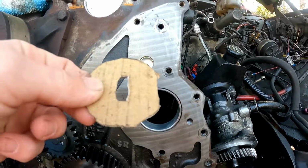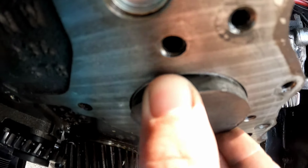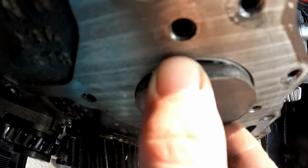All right, y'all see the cardboard? Now looky here. I made this out of 3/8 inch steel so we can put these notches in it, because you might have thought, well, Avery, how would you get this centered on the cam bearing once it's inside the block? But just like that, we can put a hole in here. It's gonna have to be more of a notch, and we can stick this in on a piece of all thread, pull it back, it'll seat into the bearing, and then we'll just tighten the thing and it'll just zoop right on out.